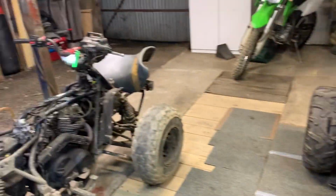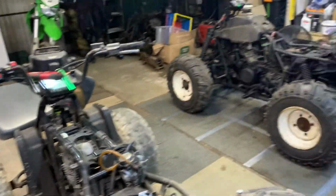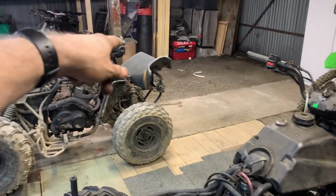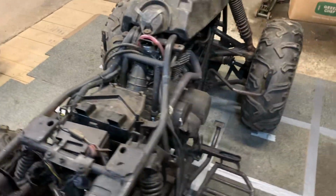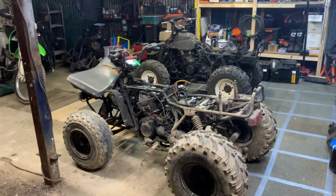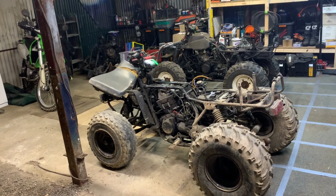Right, after all of that, jeez, it stinks in here now. Well, how about that? It's the bloody carburetor again. I could prove it by putting that one on here and it'll run crap, but that is no longer backfiring. Oh, it really stinks in here. So what should I do? I might actually move the bike around here, open that door so the exhaust is pointing out, run it up again and give it a few more beans, because that smoke coming out the back, I still think it's because I put some oil in to test the compression. So rather than kill myself, and as I've kind of proved what I wanted to prove today, that was a carburation issue. Who'd have thought that, eh? That's one of the first things that was done. Oh well, that's the point of this.